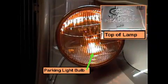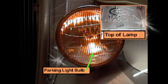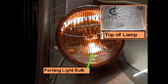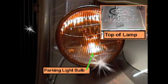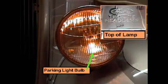A clean look was desired, and a simple way was found to include front directional signals and parking lights. Ford used what they called two-light headlamps for cars that did not have the optional cowl lamps installed. In addition to the headlight bulb, there is a socket for a turn signal and parking bulb inside the reflector — the orange bulb used is seen lit in this photo.